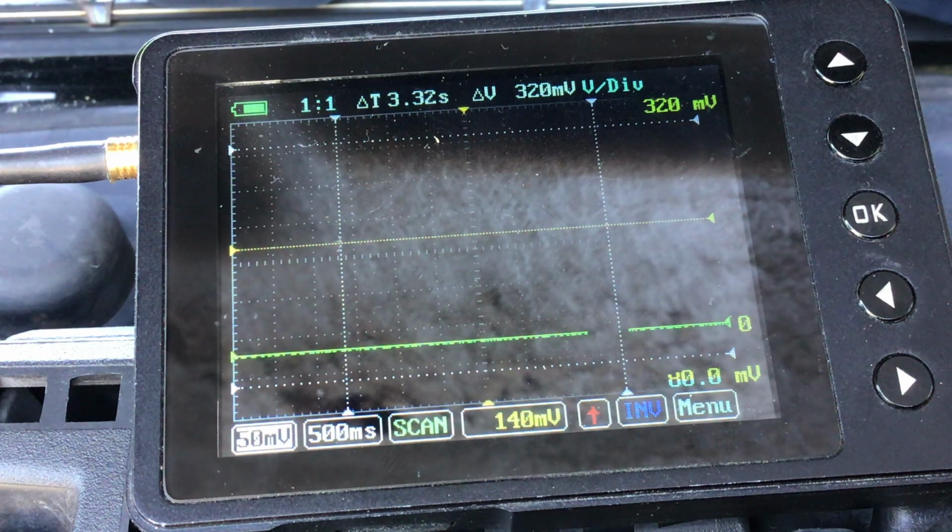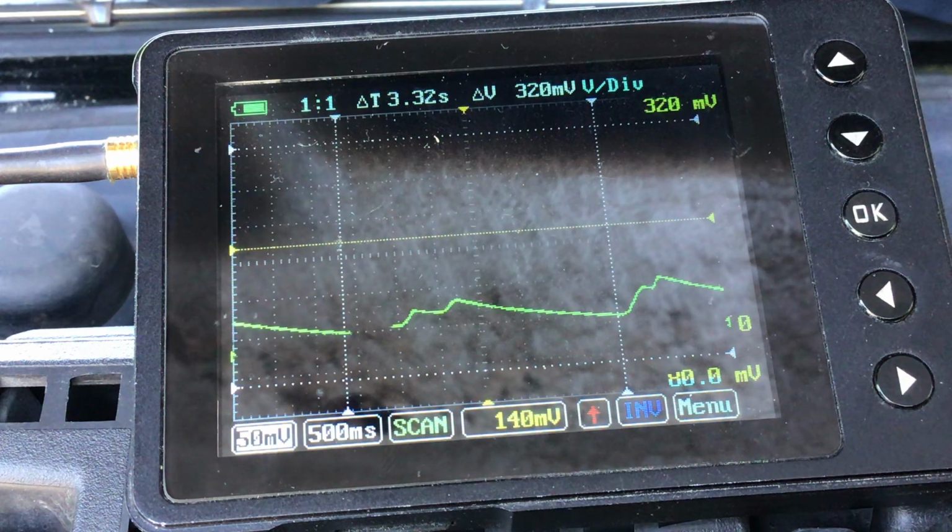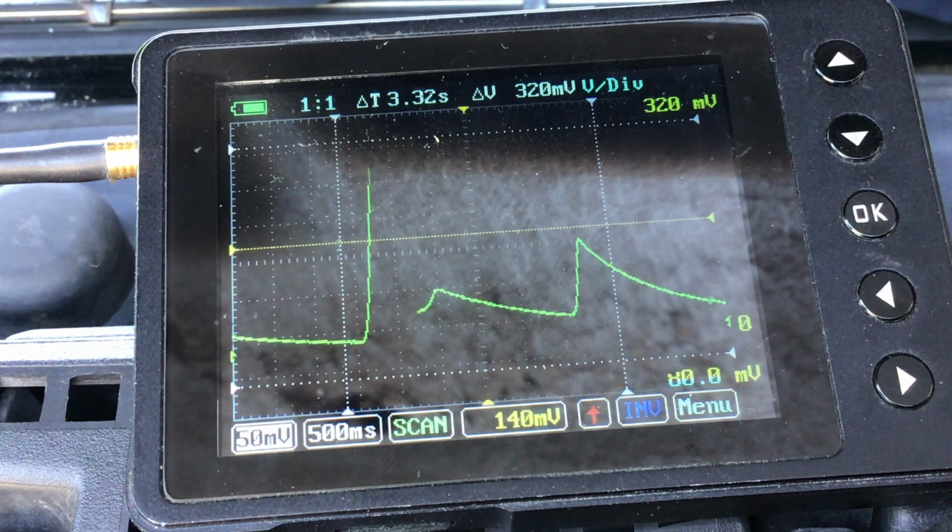Yeah, I still got to probably go through some other cylinders' compression. It will start. Okay, still going clockwise. Keep an eye on the scope. And now I'm starting to climb. Okay, I'm definitely coming up. I don't want to overshoot it, so I'm still cranking clockwise. Going up, another turn. Up.